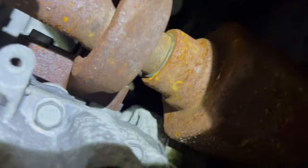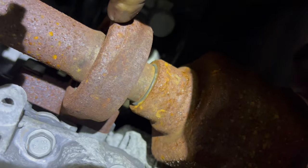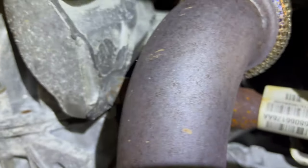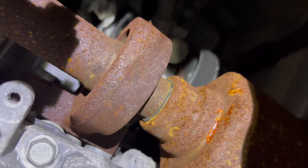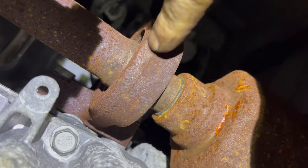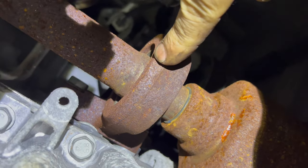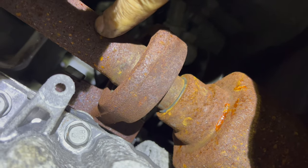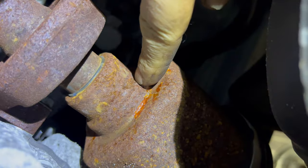I don't know if you can see, but there you see a bolt. It has three 16 millimeter bolts that bolt to the back of the block. So it's rigid and it travels across into the transmission on the passenger side. It is your passenger side intermediate shaft. This is called the carrier bearing because this bearing carries the weight of the intermediate shaft. This side is the axle, so we're going to be separating it right here.